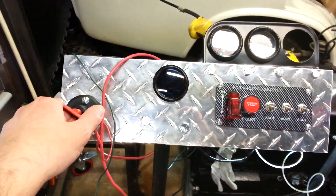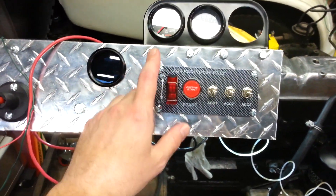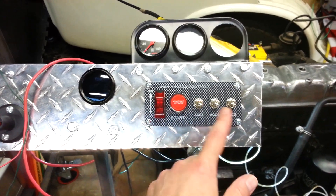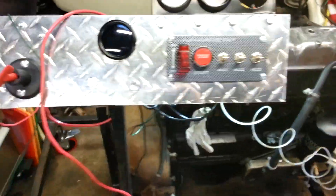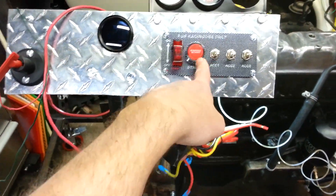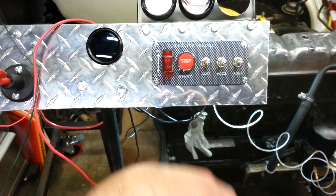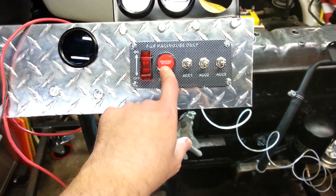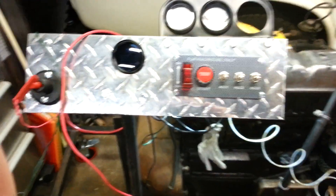For those who would like to know the way I have this test stand set up — this is my master power. Nothing happens here unless that's engaged. Most of you are probably just going to feed power here directly. This is rated for 30 amps, by the way — that's the rating on the switch, so don't exceed 30 amps. This kit also comes with a wire for the master switch and a 30-amp relay, which I believe they intend you to use if you're going to have a starting system feeding an awful lot of amperage to the starter. You don't want to put more than 30 amps through that switch — I guarantee you that.